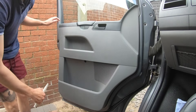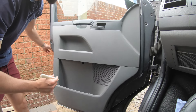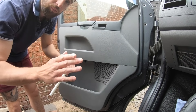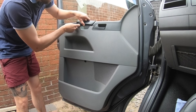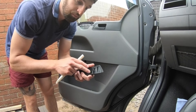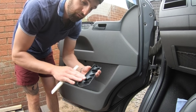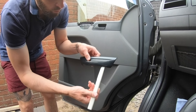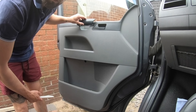First we've got this plastic panel here. Mine have both previously been off so they're not in the best condition. I've got my plastic trim tool and I've put it underneath the bottom there, taking your time, being very careful and delicate. It clips up and off. One side may already be broken — you potentially may break these. I found you want to go more upwards than outwards — it comes out better that way.